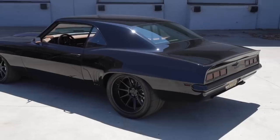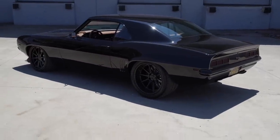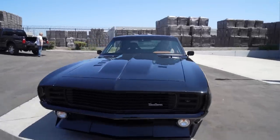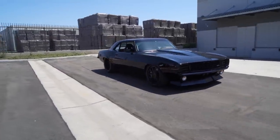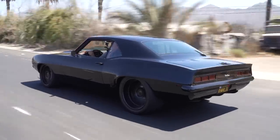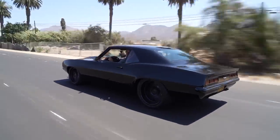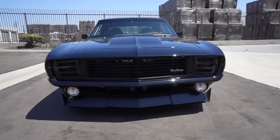I don't want to say we completely redid the car for Kevin, but we did tear the car down. We took the motor and trans out and made sure that they were healthy. We went ahead and painted everything satin black this time. We went through the bodywork, straightened the car up a little bit, shot the car black for him, and added the flush mount Fesler front and back glass. Is this diffuser different than before? We changed the rear cutout. We added a little diffuser, and then we changed the front lower valance as well.